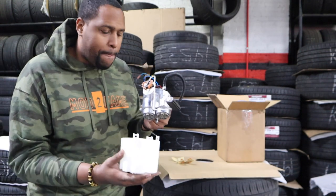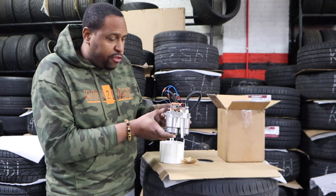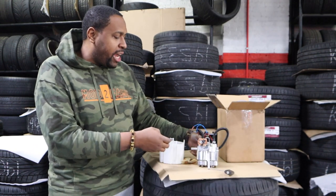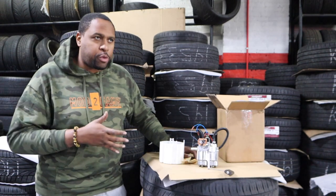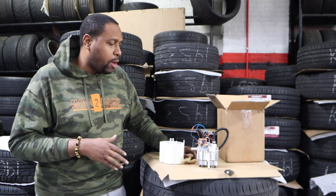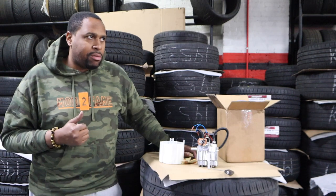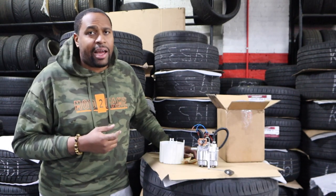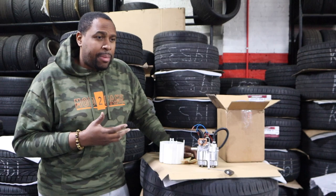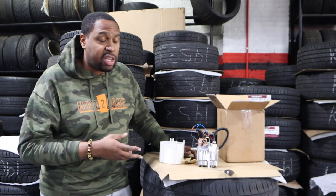The factory fuel basket is important because without it, the pumps just sit in the fuel tank and when the fuel sloshes away it can starve the pump. For example, I was about to race a big horsepower fully built all-wheel drive sequential trans Civic — big turbo, all that — and when we launched I took off and immediately my car bogged. I looked at my gauge and I had under a half tank of gas. I hit it so hard the fuel sloshed away from the pumps, starved them, and could have potentially caused me to blow my motor.